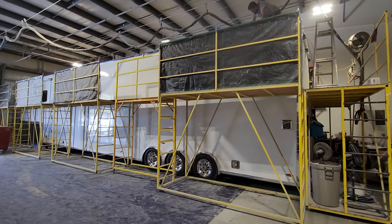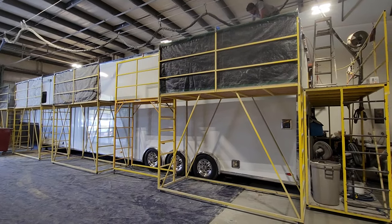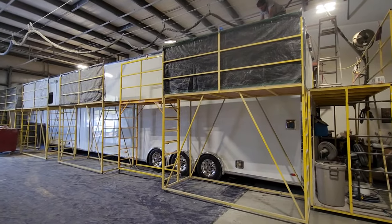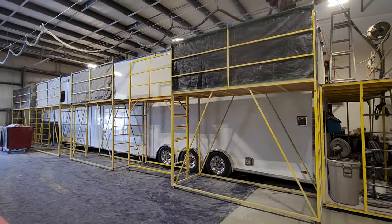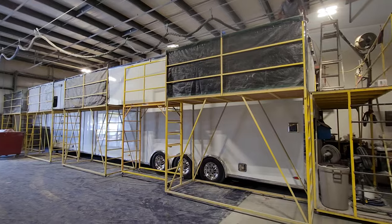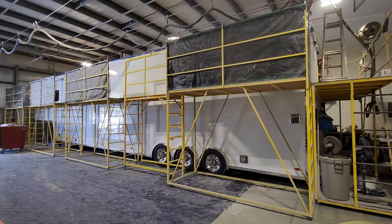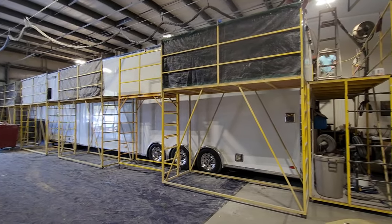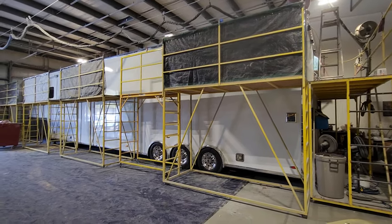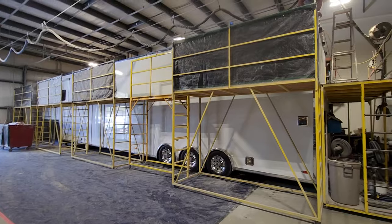This isn't a new product — it's been around for 16 years. It's been through a few different revisions but it's called polyurea. Your Raptor bed liner is made of a hybrid polyurea. The reason you can't use a bed liner on an RV roof is because it's designed for hard metal surfaces. My 2016 Ford pickup's bed liner is already cracked and peeling — it doesn't have that 500% stretch factor. Polyurea is the best. This is pure polyurea — there's nothing better.